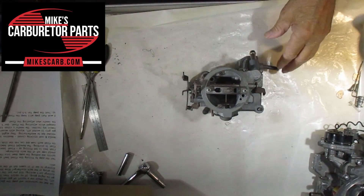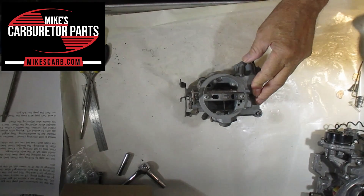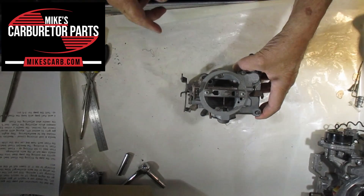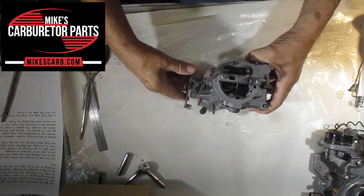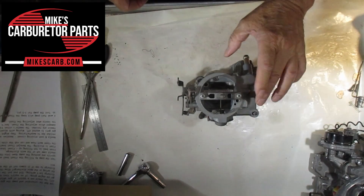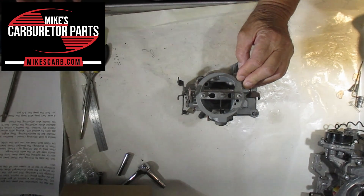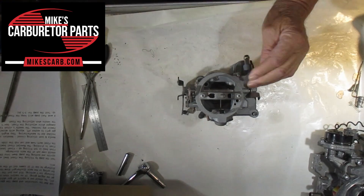Hi, Mike from Mike's Carburetor Parts. My car won't start unless I pour a little bit of gasoline down the carburetor throat, and I'm going to show you some of the things that may cause that. With the engine off, take the air cleaner off and look down the carburetor, pump the gas once or twice, and you should see a steady stream of gas squirting into the bore. If you don't, you probably have an accelerator pump circuit problem. Since the car idles okay and runs great at high speed once started, I've kind of ruled out the ignition — that's always the first thing you want to check.